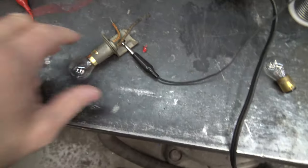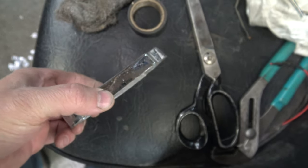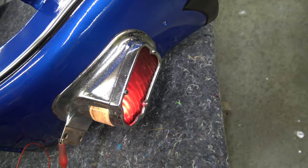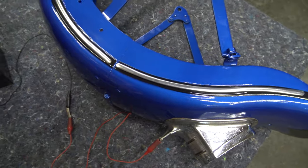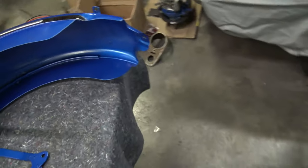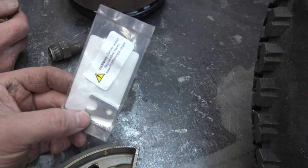Both elements work now. We'll get this fixture soldered up in that housing. I printed up some more wiring diagrams — it looks like red is the one to the switch. This is as good as it's going to get with a little bit of steel wool. I don't really like this design when it's grounding through the fender and going through a hinge. Hopefully we got connection. Eventually we're going to have to clean up a spot wherever we bolt this on so we have a good ground on this fender.